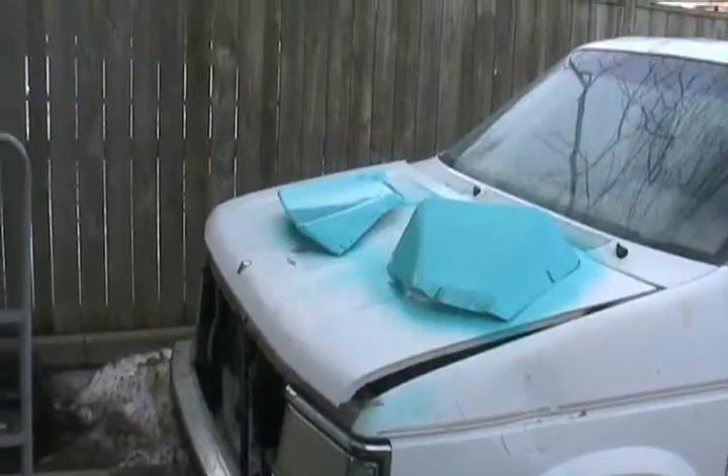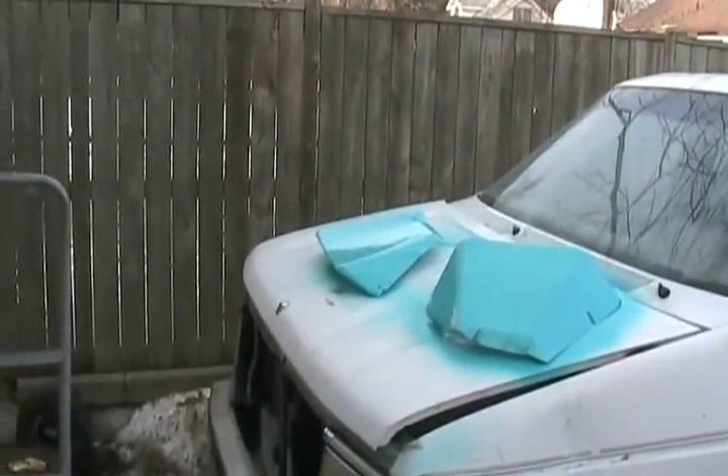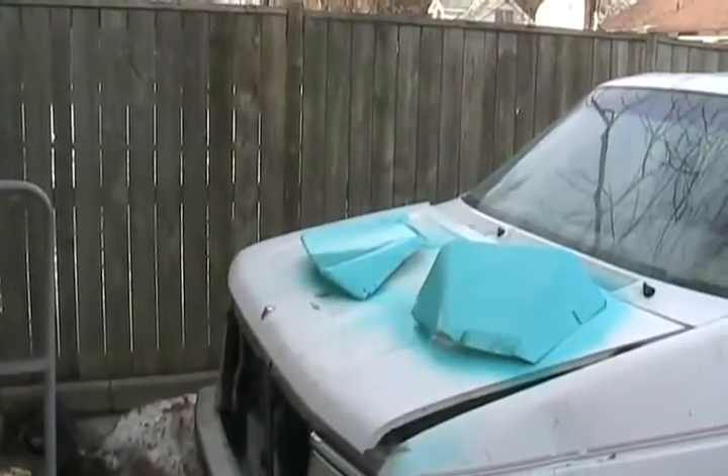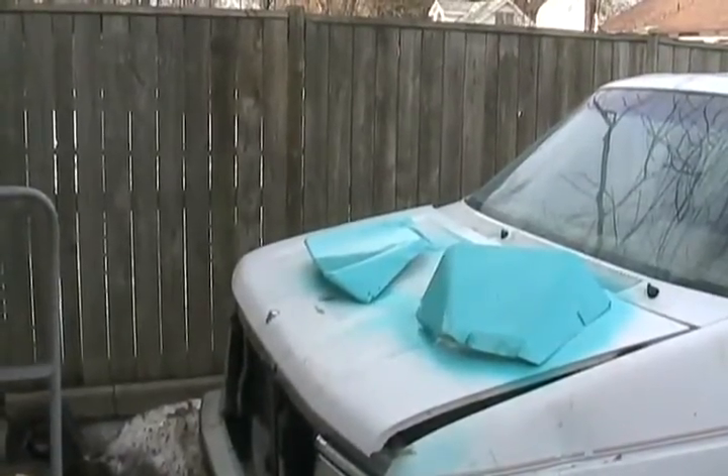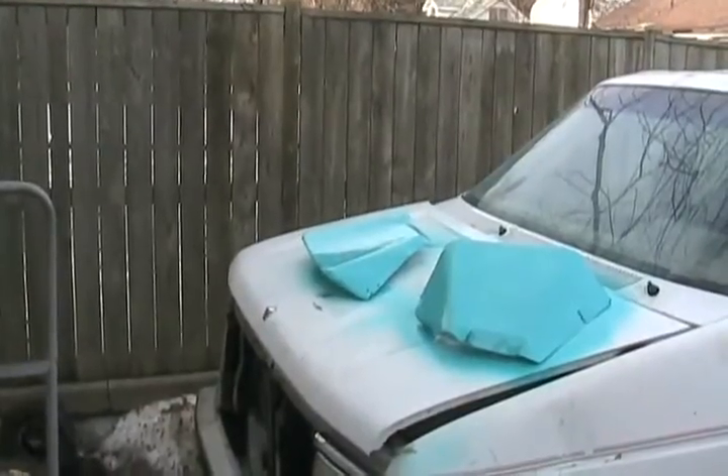And you always paint systematically — you don't go around in circles and zigzags and stuff like that. I've painted a lot of cars in my life. Also, never paint in the sun on a warm day because it'll make your paint all dry and rough looking like sandpaper. You want shade so it has time to flow after you're done laying it on.